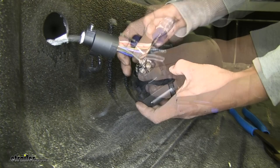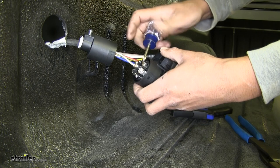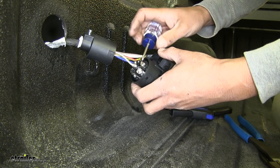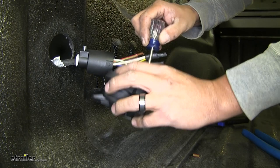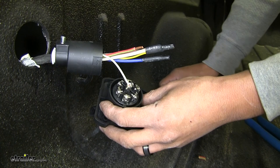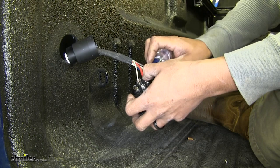So that's going to be our 12-volt power so we can go ahead and loosen that up and find which one in the legend is going to be our power. That's going to be the red wire with the green stripe. So we'll do the same thing: cut it back and strip back the end. Now with these terminals, you can see that there's kind of a flat section. You're going to want to loosen it so that it opens up like that. Take our wire and actually just put it in between the two plates. Once you have it in place, you can go ahead and tighten up that set screw. Get it nice and secure.